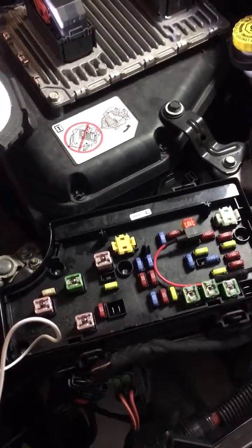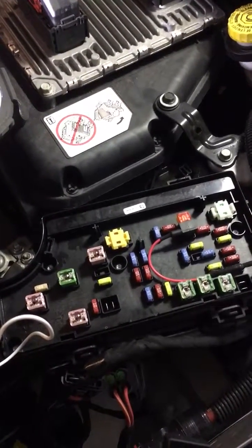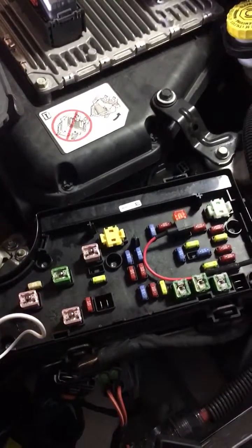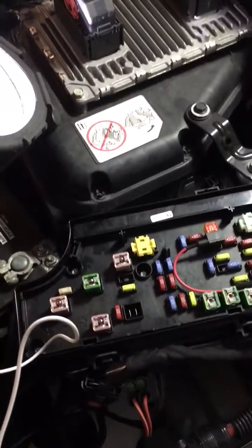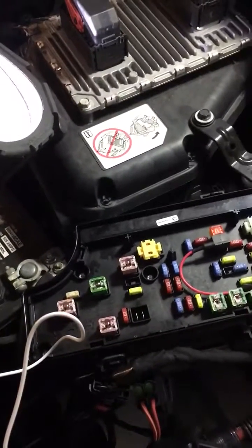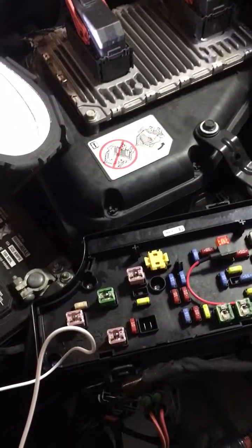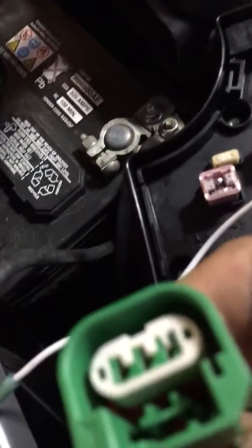resistance value for every X amount of pulses that it sends, and when it doesn't see it, it stops sending signals. That's what causes the LEDs to blink. It's the same thing with HID lights. I installed in this vehicle LED lights and HID lights, so both were having the same issue. HIDs were more steady, but the problem is because you have to use the regular harness from the car, so you still have a pulsation rather than a steady signal.